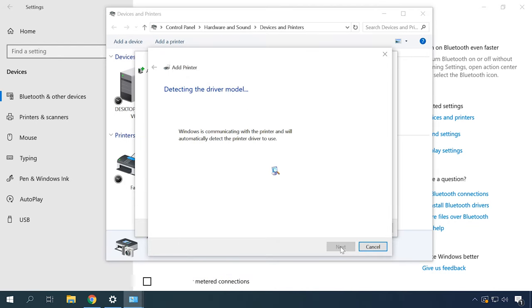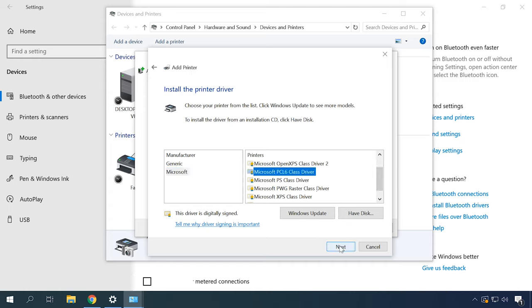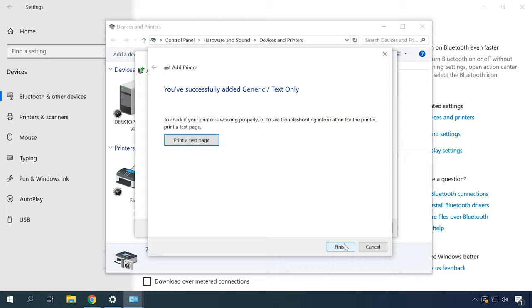Click Next. At this stage, select the device driver. You can choose the manufacturer and the model from the list. Alternatively, you can click Windows Update, wait for the list of available devices to appear, and choose it from there. You can also download the driver from the manufacturer's official website, then click Have Disk and give the path to the folder where you have extracted the driver. If you have already installed this device before, you'll be asked which driver version you'd like to use — choose Replace the current driver and click Next. Rename the printer if necessary. The printer setup is complete. When you see the message that you have successfully added the printer, print a test page. You will have to repeat these steps on every computer and laptop in your home network to make printing possible from any of them.